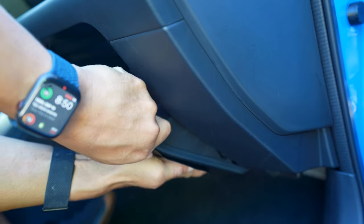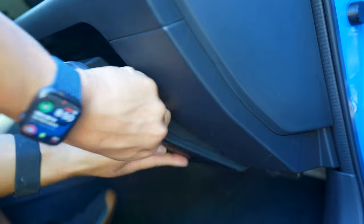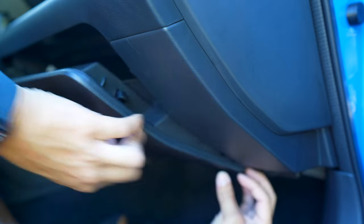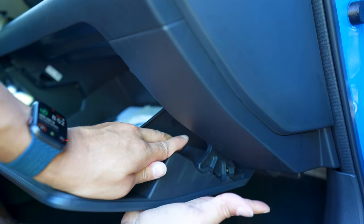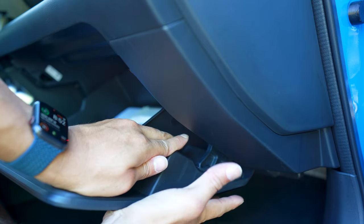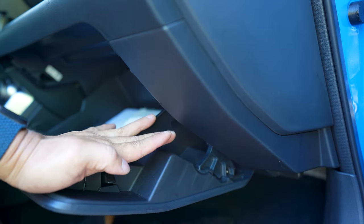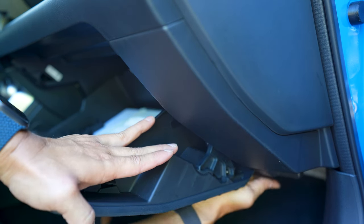I want all this material to come out to the side. If you have one of our felt tip squeegees, you can use that too. I'm using a wide area — my palm — to stretch it over the edge, because I don't want it to bunch up in any one particular place. The vinyl can go anywhere; it just can't bunch up.